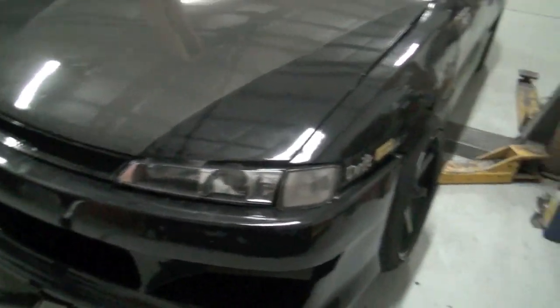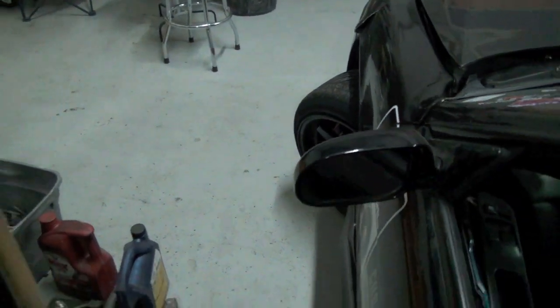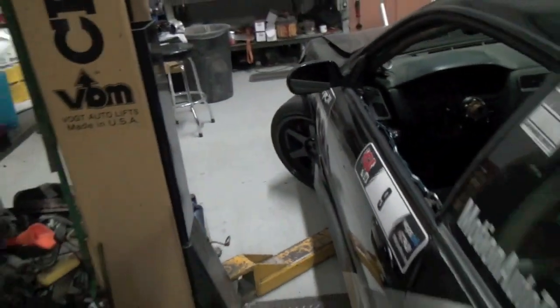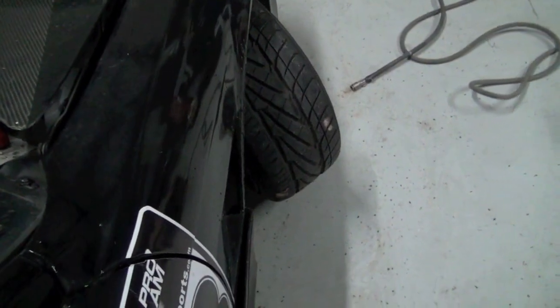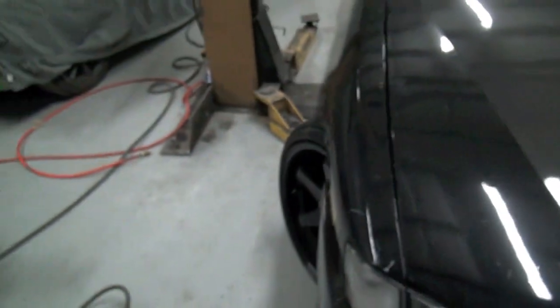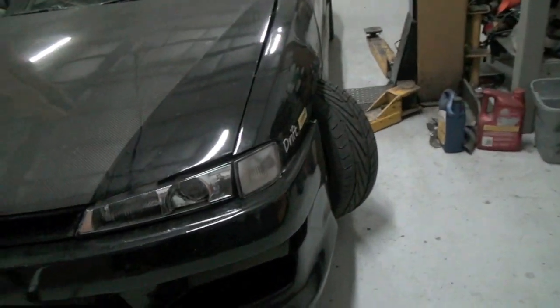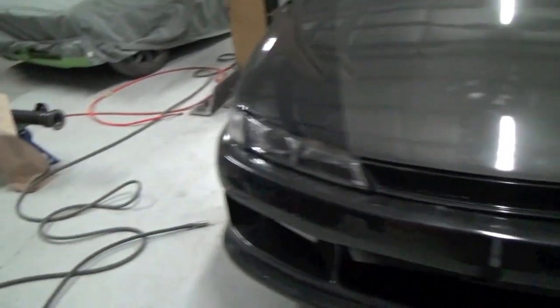With less Ackerman you're able to drift a little bit faster, though you have to left-foot brake a bit more. Here's the driver's side at full lock — that's the lead wheel — and the trailing wheel doesn't have quite as much angle. I'd like to knock that down so the trailing wheel mirrors the lead wheel exactly.